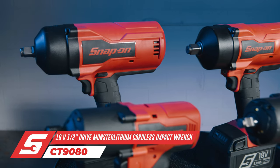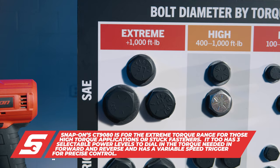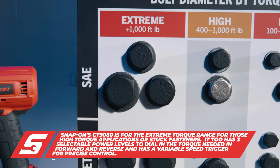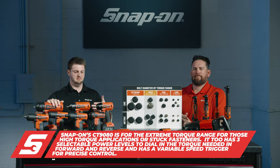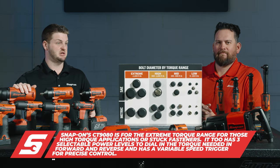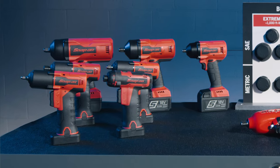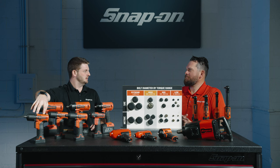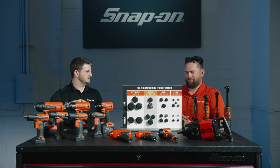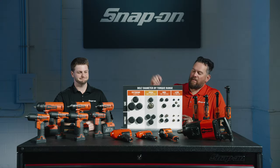Jumping up from the 9010, the 9050, and now to the extreme — the 9080. The 9080 is the big dog of the cordless group. This is for your extreme torque range, very large bolts, heavy duty applications — trucks, large vehicles, and really stubborn stuck fasteners. If you're in the rust belt trying to break things loose, especially suspension, this is it. Think about this as a family: you're not going to use the 9080 on an oil pan, and you can't use the 861 for lug nuts. You need the whole range in your toolbox.